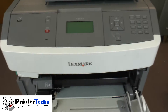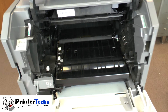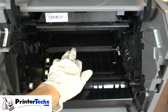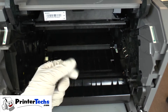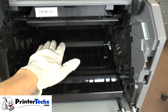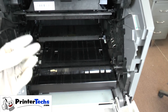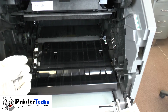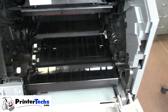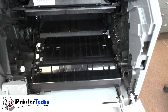Open the toner access doors here and make sure the toner is removed. The transfer roller is this roller right here. Now the reason why I'm wearing gloves is you want to try not to touch this with your bare hands, either the transfer roller or the charge roller. The oils on your fingers can affect print quality, but if you don't have gloves, don't worry about it — you can always wash your hands, make sure they're clean, and then you shouldn't have any problems.